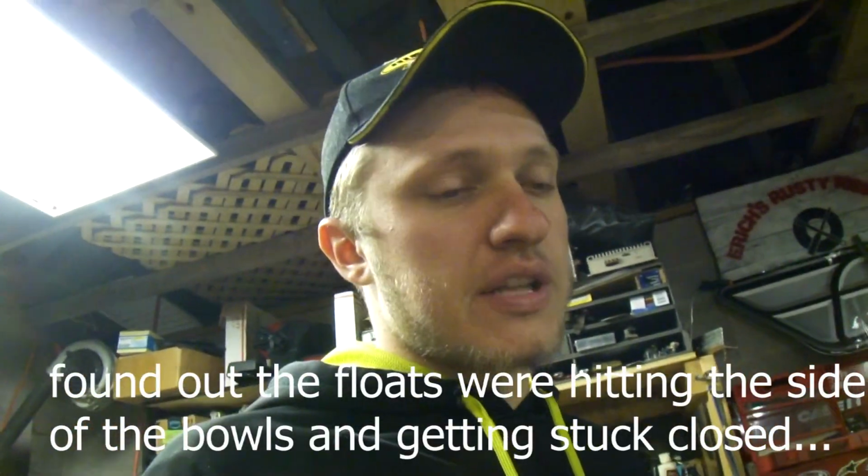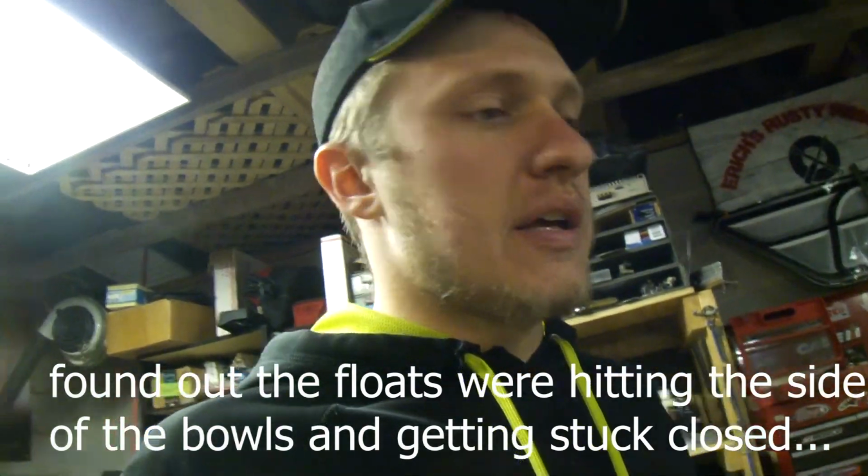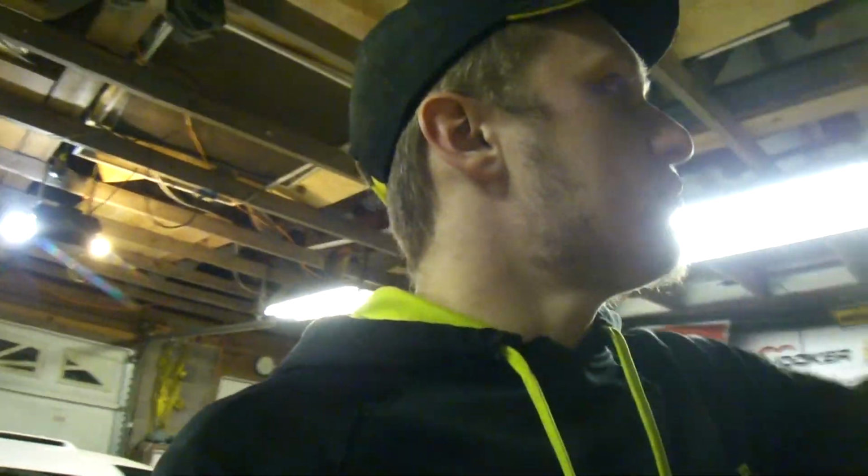Anyways, the silver car, I got it idling. It's a pain to start, and I don't know entirely why. It's not the motor, because it's just not getting fuel. If I pump the throttle up real good, it starts. So I'm going to get some idle jets coming, and I'm going to pull the jets back out whenever I walk over to the house. On the Weber, it's super easy. But that'll be coming in a future video, just kind of the tuning. I've got a big Innovate wideband, the handheld unit. I'll put on that, and then we'll just go right to town tuning that car.